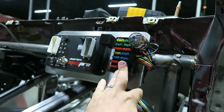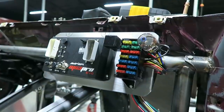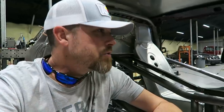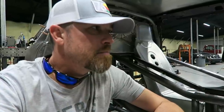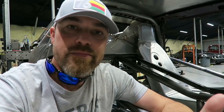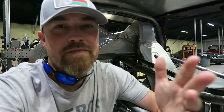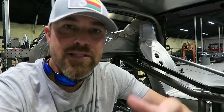There's some things you just don't want running while you're trying to start your vehicle, like a fan, stuff like that. It doesn't need to be drawing power when you're trying to start the car. And then what you'll find is there'll be a couple of them that are just on during the accessory version. So you're not powering everything when you just want to kick on the accessories, park lights, radio, stuff like that. And those will also be on during the run portion as well. But you won't be powering like the coils, the computer, all the stuff that you don't need, the dash. You won't need all that stuff when it's in the accessory position.